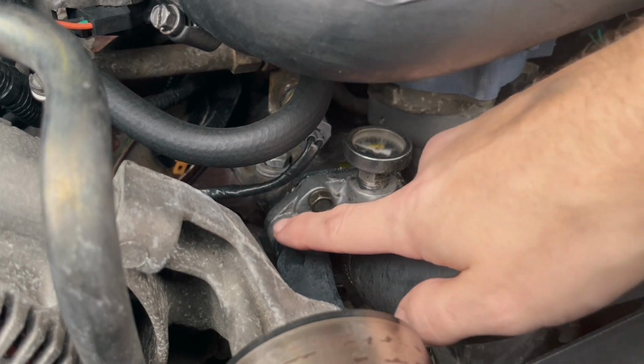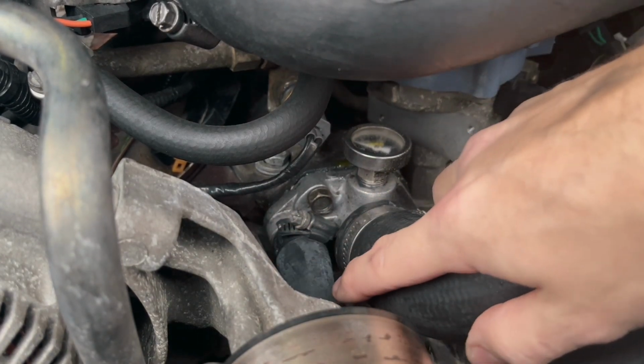Same basic stuff, really. 97.8% of all aftermarket AC kits west of the Mississippi use AC fittings like this, the little crimpy doodad, and just a standard barrier hose. At first, it looks like hydraulic hose, but it's not, so don't use hydraulic hose. But nothing kills my chubber faster than seeing heater hose lines with 1920s hose clamps attached to them. But you can actually use these little guys.